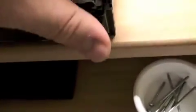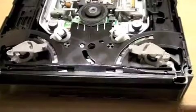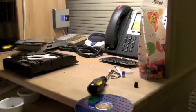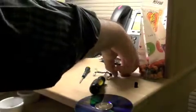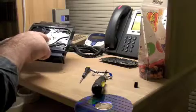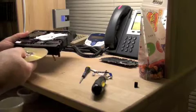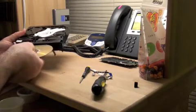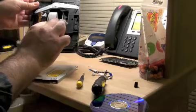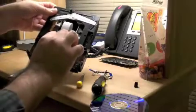Because when you let go of it, it'll take this thing back to the left. It's a pretty poor mechanism if you ask me. Once you're satisfied with that, secure the top with the five black screws. Make sure you put your hub clamp back on. Once you've got this thing screwed down, test with your CD again. If it stops right here you've got a problem. Make sure that all the cables — the stepper motor, the one for the laser, the one for the spindle motor — are all routed underneath their catches.